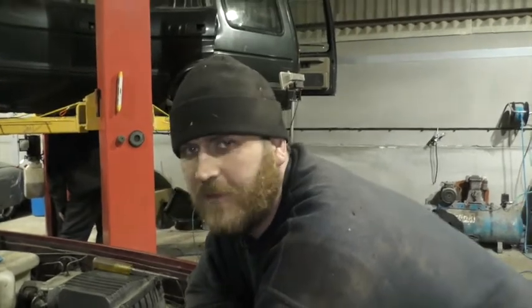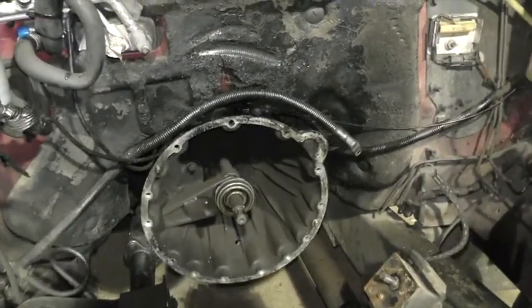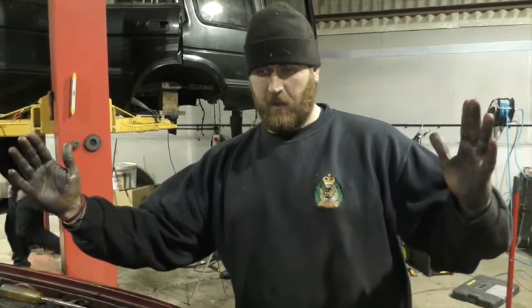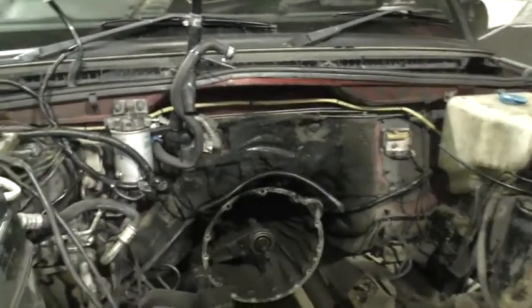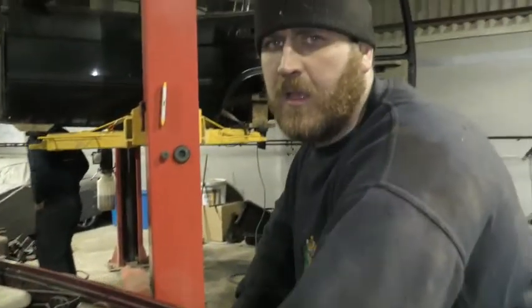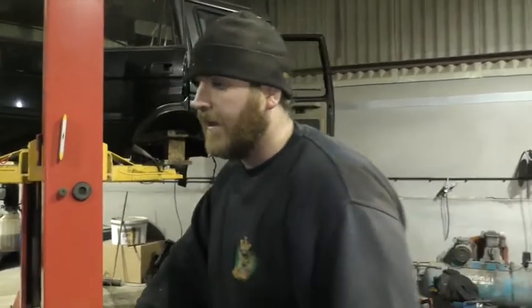It caused us a lot of headaches because there were a lot of hidden bolts when we came to take the engine off. And again, if you can see on the camera how tight the gearbox is to the wall of the vehicle, there's literally nothing you can see along the top. We ended up having to pop off the cover, which is riveted down inside. So we had to put an extension on that was about that long, so that we could reach from where the gear stick is to where the bell housing meets the engine, just to be able to undo the nuts. That also didn't help because somebody had used some Nordlock nuts, which are designed to go on as a safety critical nut, and they're not really designed to be undone easily. So that caused us a lot of time and aggravation. So yeah, that's where we're at with the engine, really.